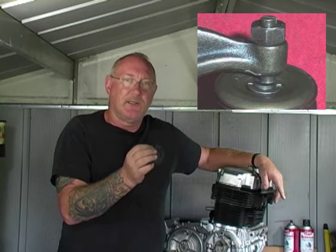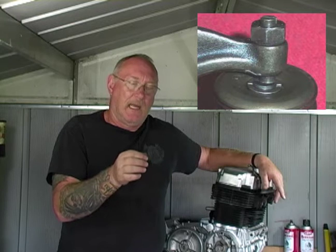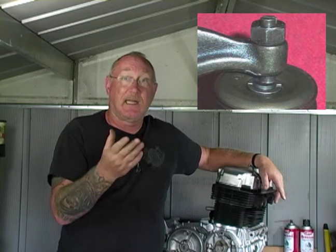It's called a screw-type adjustment. What that means is there's an adjusting screw in the end of the rocker arm just above the valve stem, and the clearance is set by adjusting that screw in or out to set a gap between the end of the screw and the tip of the valve.